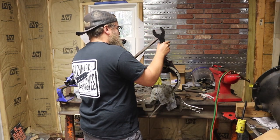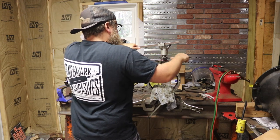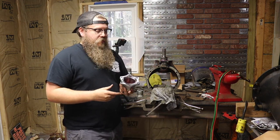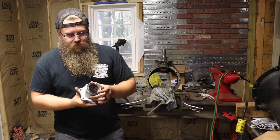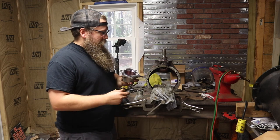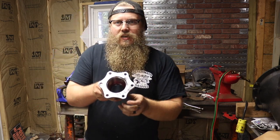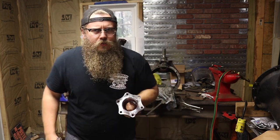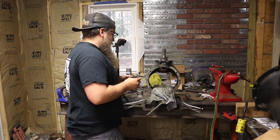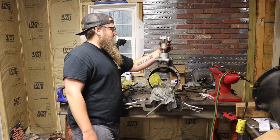The center section is complete and we're just about done with this whole assembly. The next step is simple: put the cover back on, making sure the seal is already hammered in place and greased up on the inside. One thing to remember — there is an oil drain at the bottom of the pinion on the outside; make sure that drain is not covered. I'm going to put a little bit of black RTV on both sides, put the gasket on, and bolt it down. Once that's snug, all we have left is the yoke and the little pins to retain it.